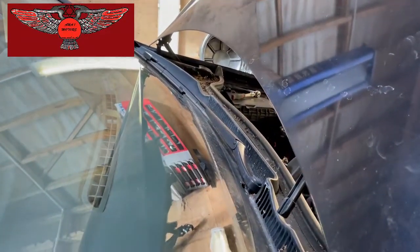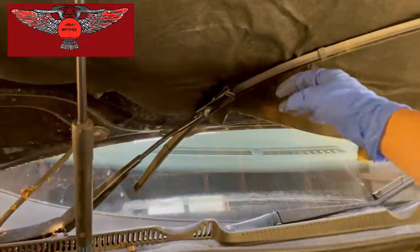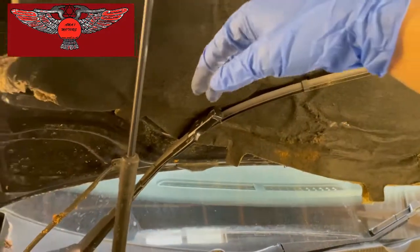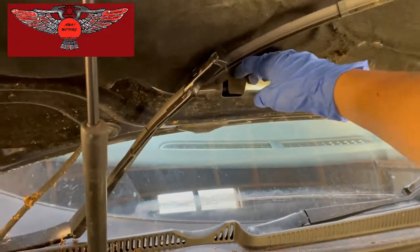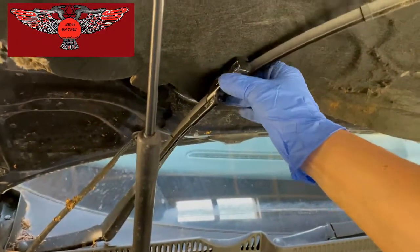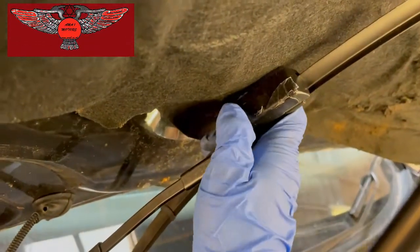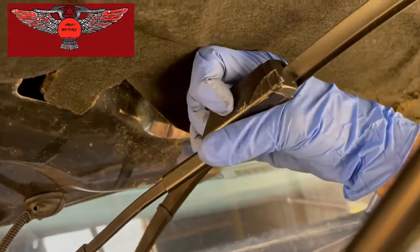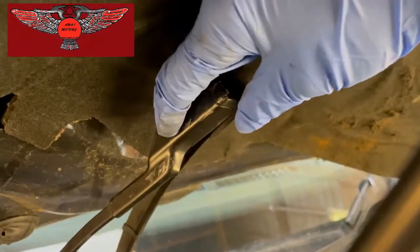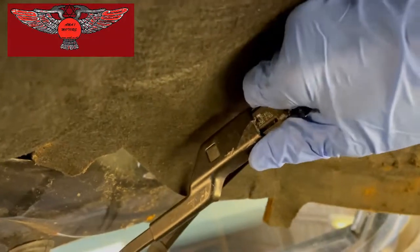I'm just going to change the front wiper blades and I've opened the bonnet here so I can open the blade. If yours is not falling apart like mine, all this part here, then it might look a little bit more tidy. Anyway, get your blade open and up, then all you need to do is press on that little square there, press on the square and bring the wiper that way — easier with two hands — and there we are.